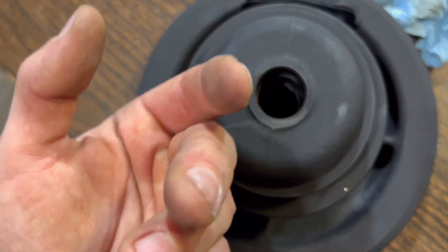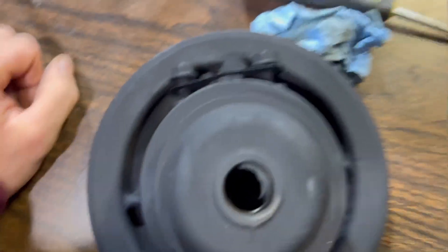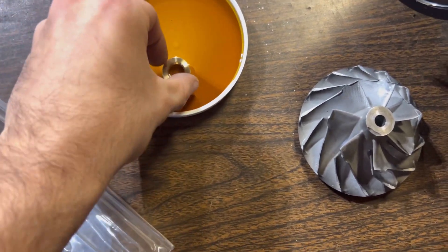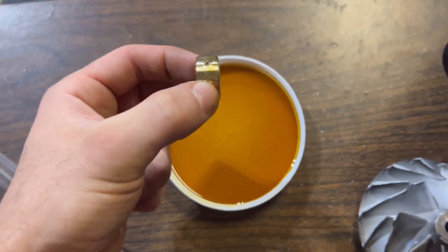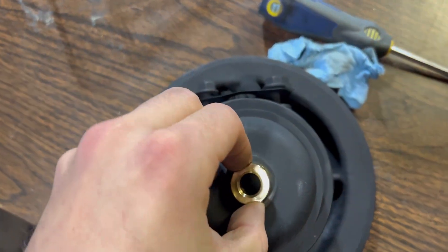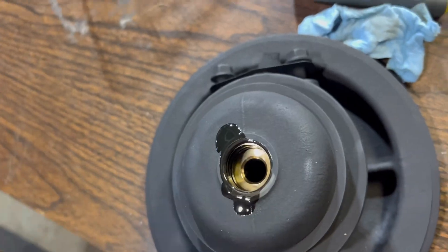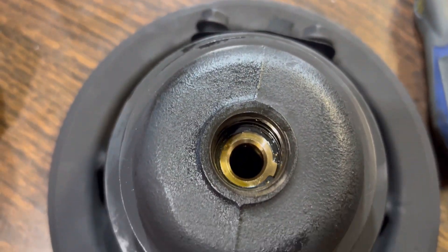Go in from the other side, hold it up with your finger, and then on this side use a screwdriver until it goes into the hole. Everyone will find their own way to do it. Next goes in the journal bearing — you're going to want to grab a container or just pour some oil on your journal bearing because you don't want these going in there dry, especially when you first start the truck. Coat it pretty good, then throw it in there. It should be laying on top of the snap ring you just put in. Then take the next snap ring, put it in the top groove — journal bearing sandwich. The sandwich has been completed; the top snap ring is much easier to get in.